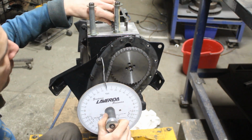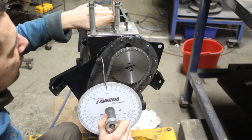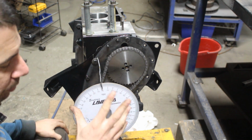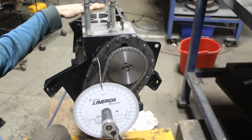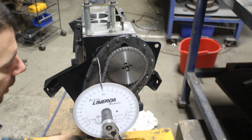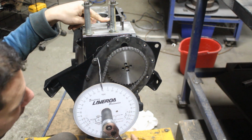With our piston stop. This is what I said earlier. This bolt here is acting as a piston stop, so now we know that we are more or less there, pretty much there, because we see the fourth piston is all the way to the top. But as we know, the top dead center of the piston lasts for 2, 3, 4, I don't know how many, but a couple of degrees. So we need to find the exact one.